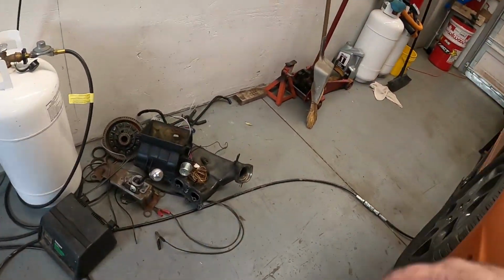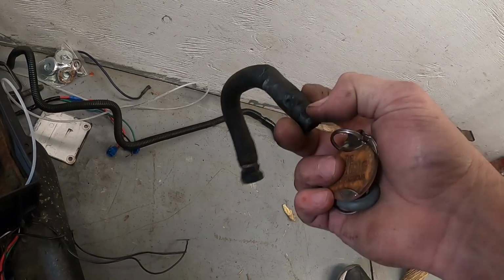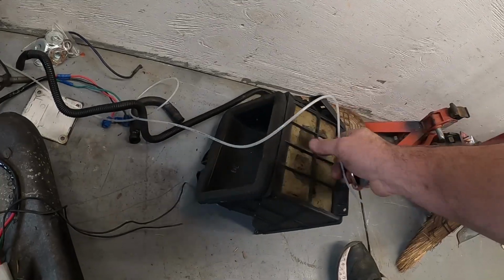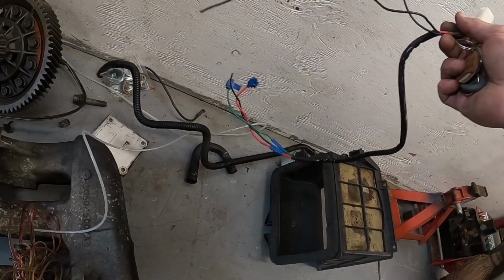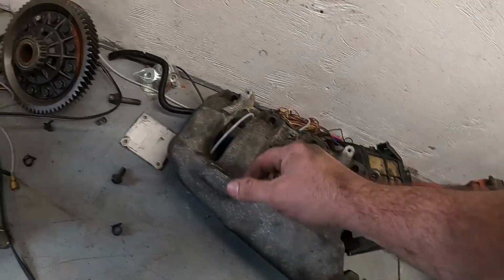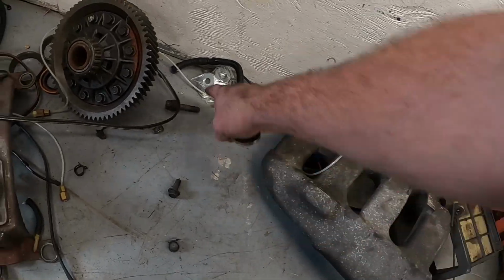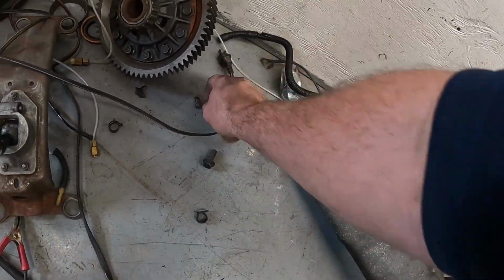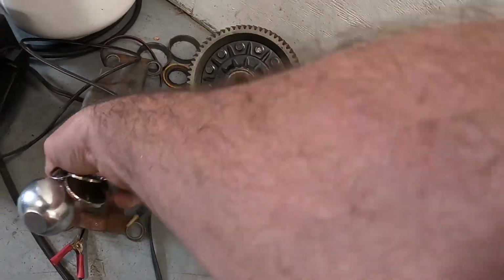I mean, here's some of the extra stuff. We replaced this hose here. It was worn through. You can see here and there. So we replaced that. Recirc box had a chew in it. They had something going on here with this running for the boost gauge. This wiring was tucked in. Here's more wiring that was tucked in. The broken intake. It had a broken heat shield, which is quite common for them. Here's some of the stuff that was holding the other shifter in. A trans bolt I replaced, a broken clip, some more stuff, our damaged shifter.